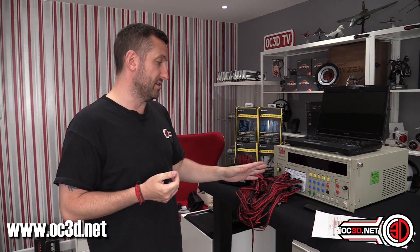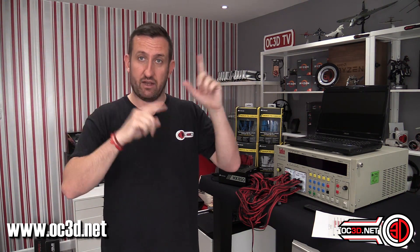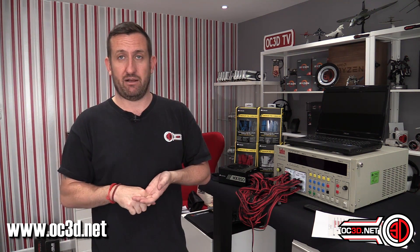You've also got those customising options, and if you do want to get aftermarket Corsair cables, just remember to get the Type 4 Gen 3 ones. I'll put a link underneath from Johnny Guru so you can visualise what cables you might need, since people often ask if Corsair cables fit other brands — sadly they won't. Corsair does have a nice compatibility chart now. The website is still listing them as RMi or RMX cables, but you can use them for the new HX as well. Hopefully the website will get sorted fairly quickly.